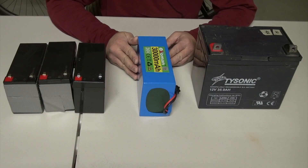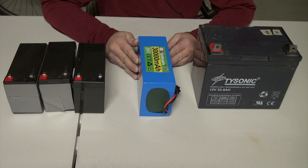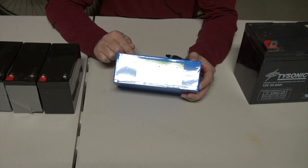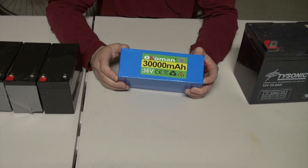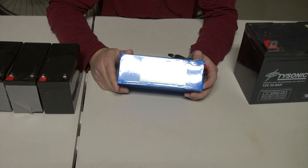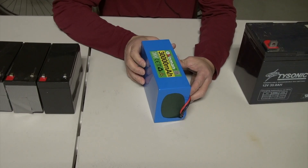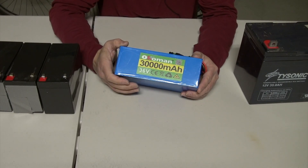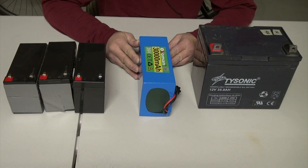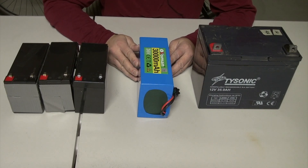The first item is the lithium-ion battery pack. This pack allows me to do so much more given the limited space on the bicycle for battery storage. Inside this pack there are 50 battery cells — the 18650 cells, the same battery cells used in the Tesla Model S. This is incredible technology in terms of battery improvement and packing more power density in a small package. The first advantage is its size — comparing to the old batteries, the smaller size gives more possibilities for where to store the battery.